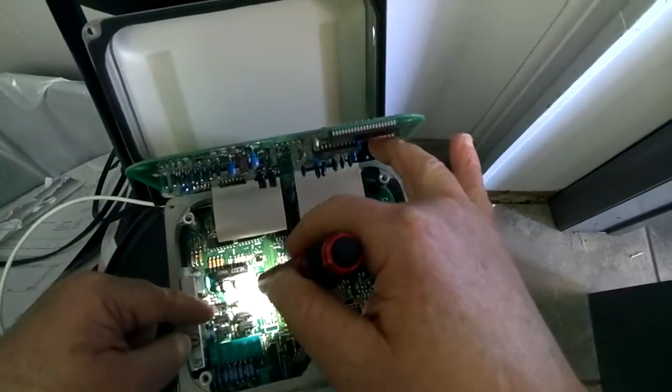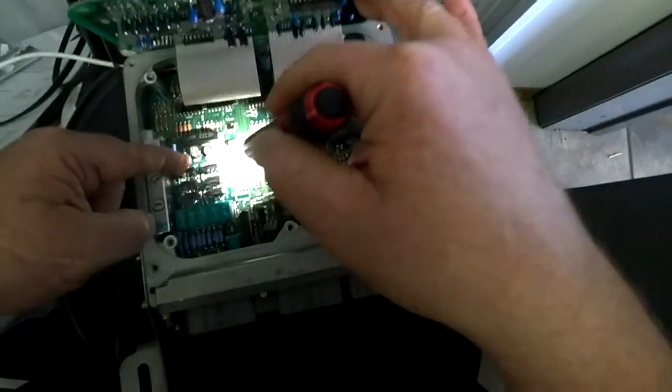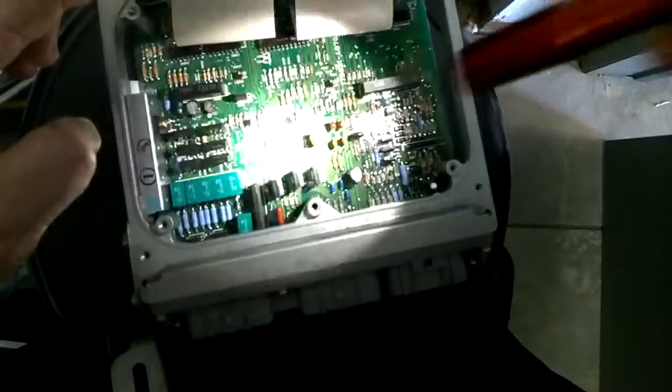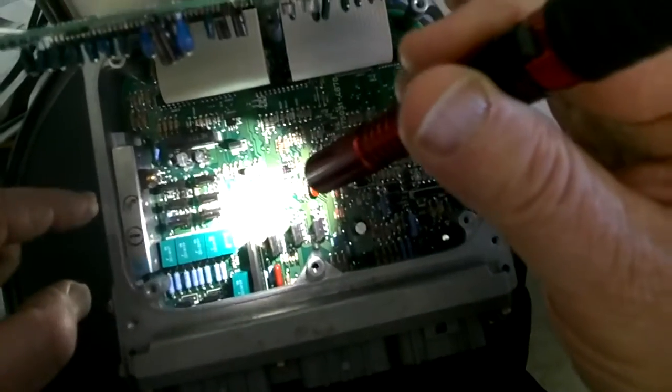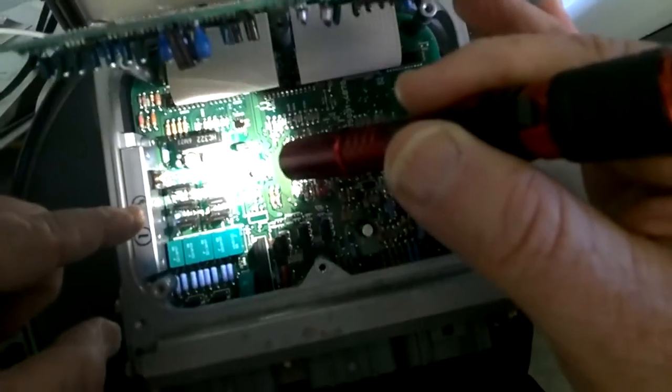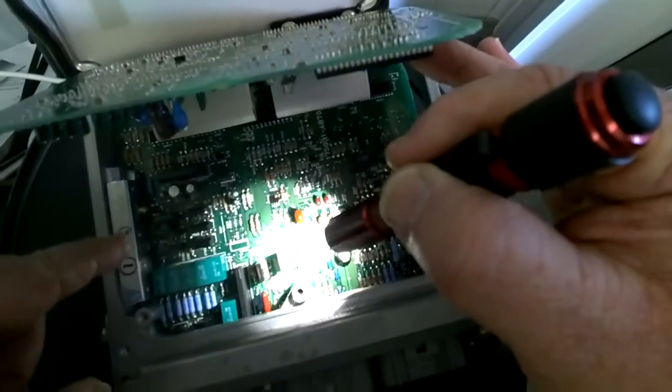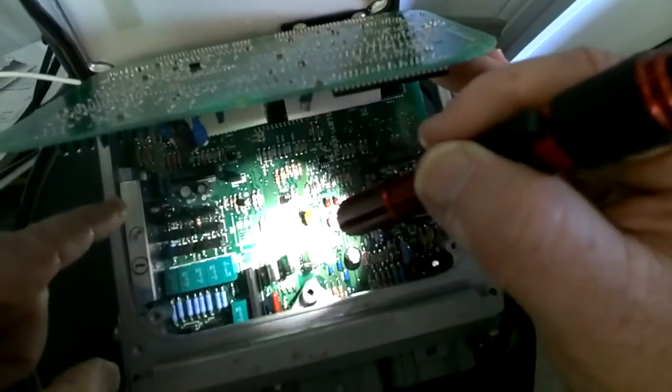Right down here you can see some leakage. We'll try and get pretty close as we can — you can see some of the leakage that's coming out, in between the solder joints on the fuel injector drivers, which is why the injectors are giving a problem. We're also seeing the processor fire off two injectors at the same time.